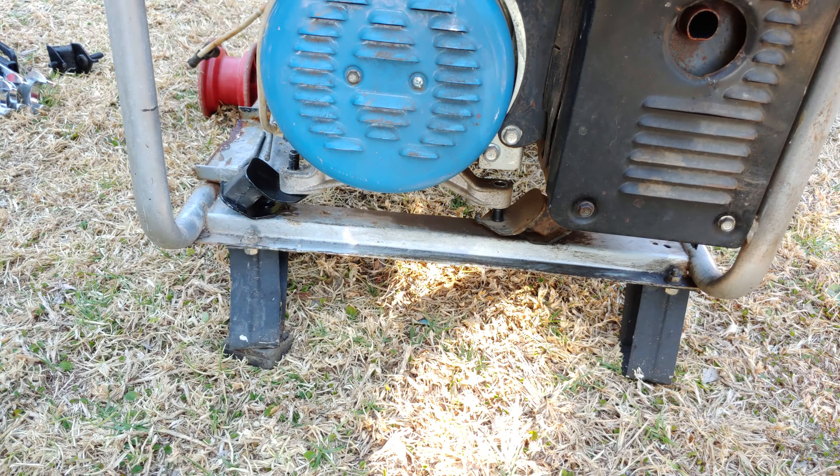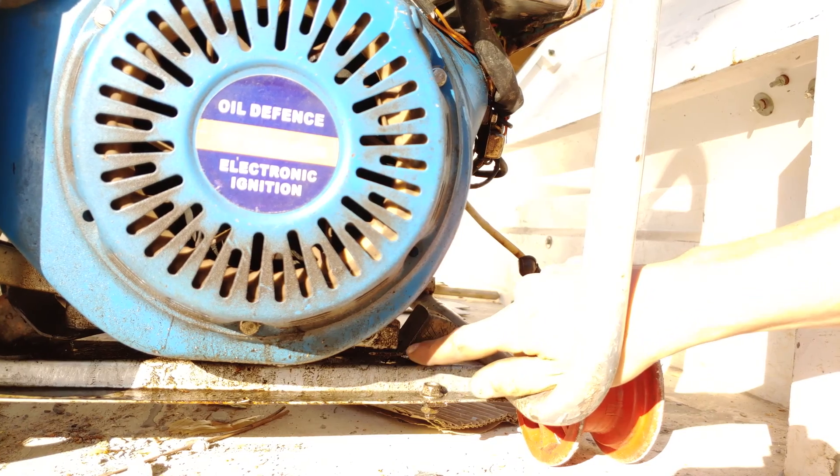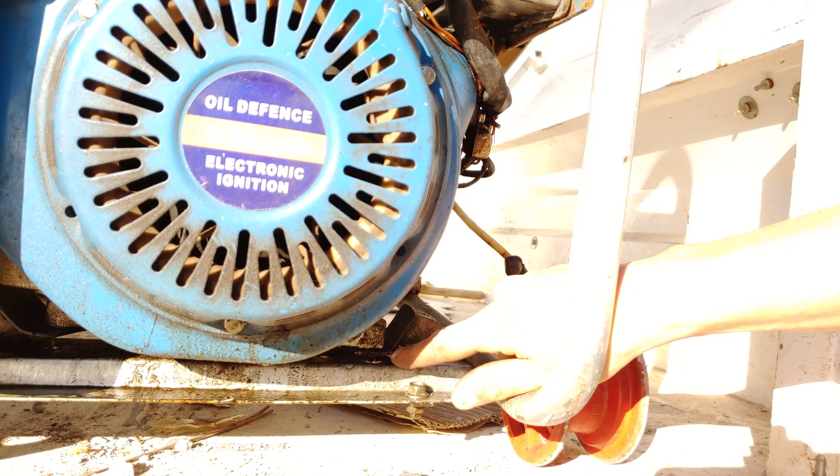I'll put the bottom nut on but leave it loose because I'm going to change one other mounting on the other side. As stated, it's best to change all four mountings. However, even if you have four mountings, sometimes the quality control is not very good — you might find two are firmer than the other two. My experience is that they can be a little inconsistent; sometimes you'll get four from the same company and find one is firmer, which affects engine alignment, as shown a bit later in the video.